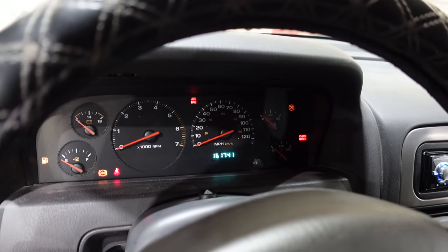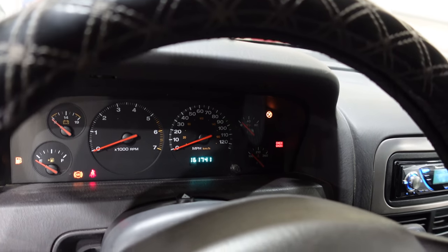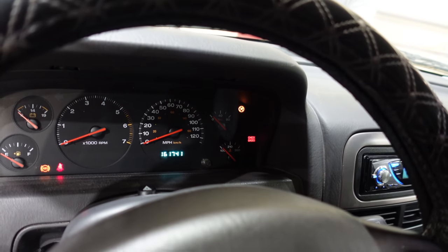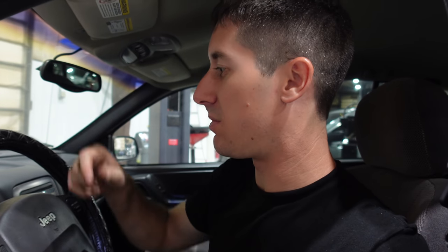The tricky thing, as many of you guys noticed, is the sentry light was on, which is the immobilizer. These are the right keys, so hopefully I can go through the 10-minute wait process and it kills the sentry thing. There's that sentry light — oh, it went out... oh, it's flashing and staying on. Of course it's out of gas too. The gauges aren't on because of sentry, but it should crank — it had fuel in the rails. When that sentry light is on you get no gauges and no fuel pump. After tons of reading it looks like HP Tuners can't delete the SKIM module. The only way you can actually fix this problem is to send the ECU off to be reflashed by a handful of companies, or run to the dealer and have them make a second key — you have to have two keys.